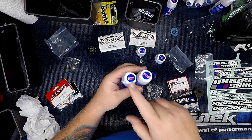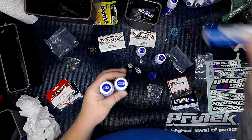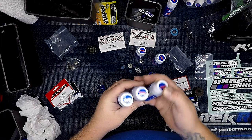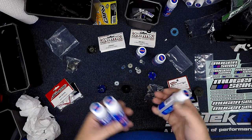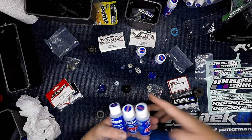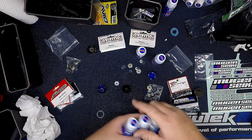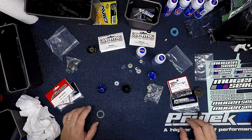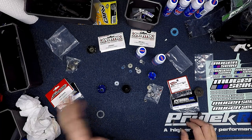You've also got 10k, 15k, 7k, and 5k options. You could try 10k front, 10k middle, and 5k rear if you want some control and actually want to drive. But I found with 6S power it works better to kind of lock the diffs up with thick stuff, and I believe it works out better in the long run with 6S.